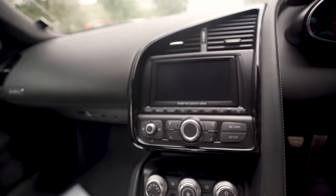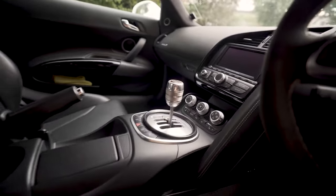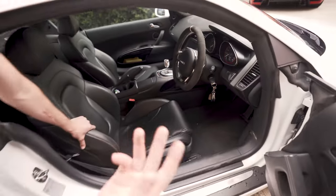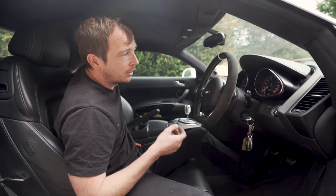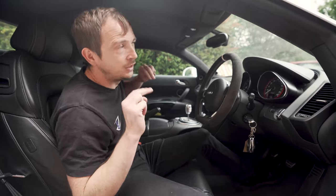Obviously then, you've got two types of transmission, both based on the L156 Graziano box. You'll either have a six-speed manual, or six-speed Tronic, or E-gear if it's a Lamborghini. They're all the same gearbox. They're just how it's controlled. So it's automated clutch and automated gears, but it's the same manual-style gearbox.